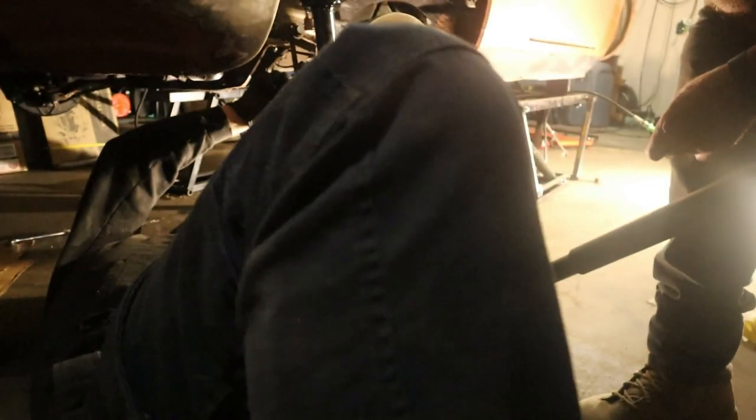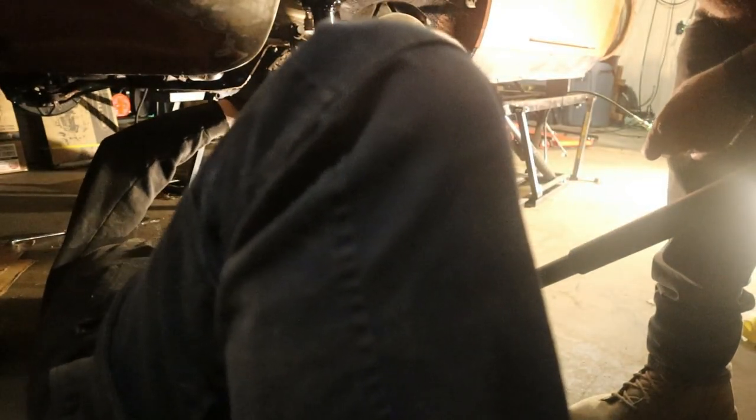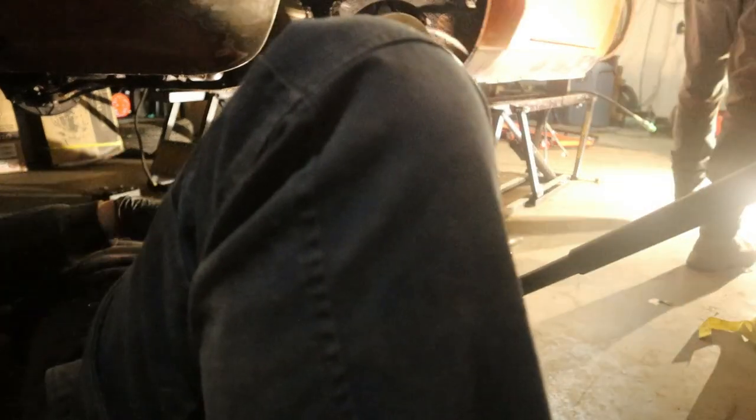Alright. Let the jack go and push directly on this piece of rubber, and jack right up here. Why don't we put a C-clamp on it? Yeah, you can grab the C-clamp, but it might just eat this bushing. That's what I'm concerned about. Put the washer on and put a C-clamp on it. Yeah, we can give it a go. There might be a C-clamp on the desk over here, still on the far right. Yep. Put the washer on it, we'll put the C-clamp on the washer.